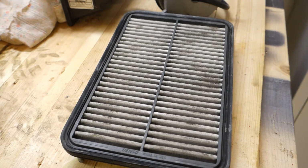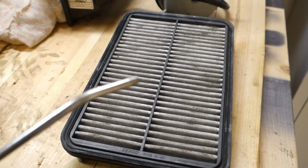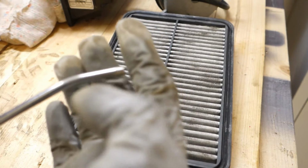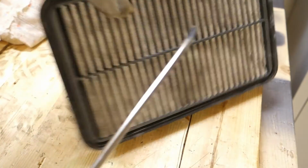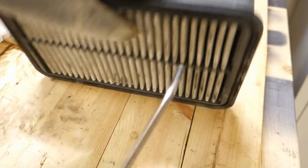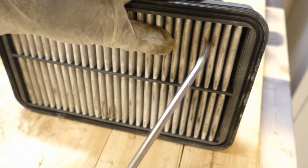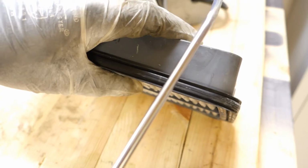with compressed air. The air comes out here, and remember to use gloves because compressed air is dangerous if it goes directly to our skin. This cleaning happens so that we always clean it from the outer area to the inner area. We insert the compressed air from the inner area, and then we clean a little bit in this direction, so that the air goes in that direction, because normally air goes in here to here.